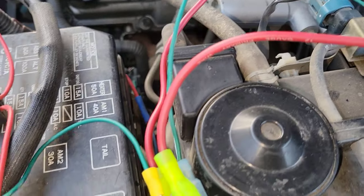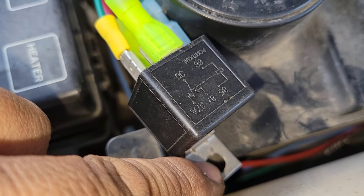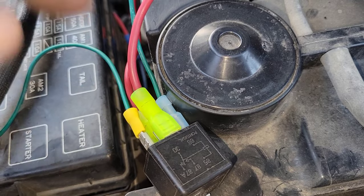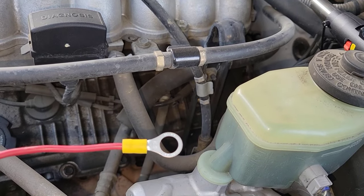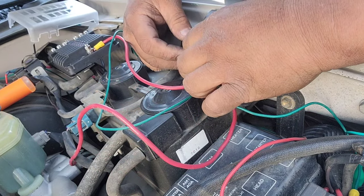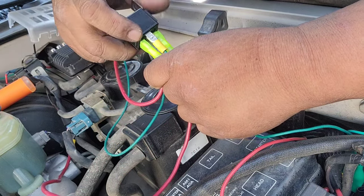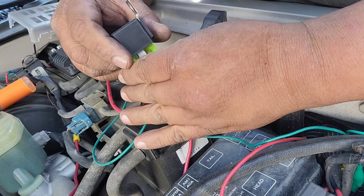This is the other end of 86 and 85 — I'm going to ground this right here where I'm attaching the relay. Once I'm done with that it's going to work, but I have not yet installed this onto the battery terminal — once that's done it'll start working. I'm going to wrap this with electrical tape so that it'll be isolated — no water or metal will land on the relay.